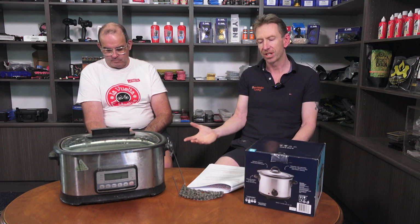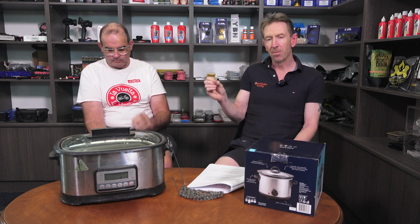Because if it's sounding and feeling terrible, what that means is that basically all of your lubricant layer has been abraded off, and you're now more or less running metal on metal, or metal on metal with some grit inside it. And so your chain is going to go from being a 3 to 4 watt chain to a 15 to 20 watt chain. And that's not great. Especially when you're completely knackered in a massive event, you want all of your watts as much as possible pushing you further forwards every pedal stroke, as opposed to being lost to friction in your chain. So what are the best options?